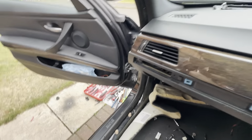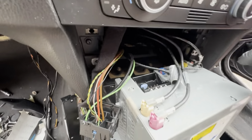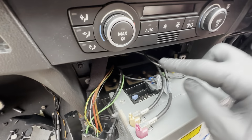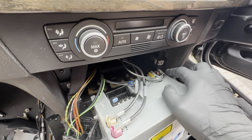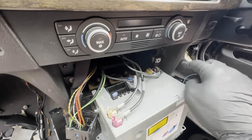Now, moving on, I might as well cover all the connections while I'm here. So FM AM connection, DAB connection. The cables are actually the same for GPS, DAB, FM and AM, and TV signal. They're all the same. The only difference is the actual connectors and the color coding on the connectors. They have idiot proofing, so you can't mix and match them.